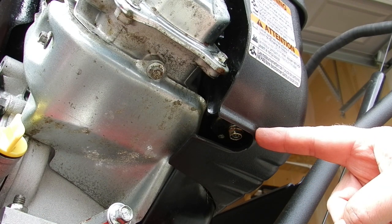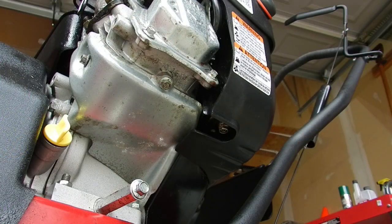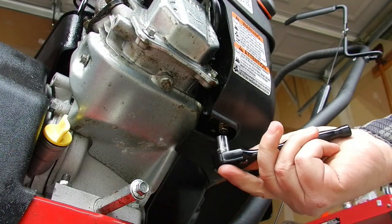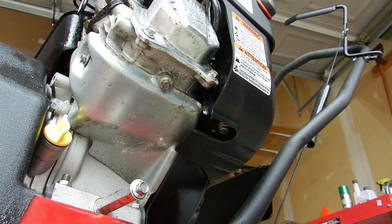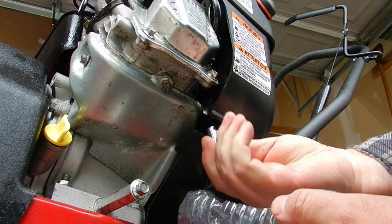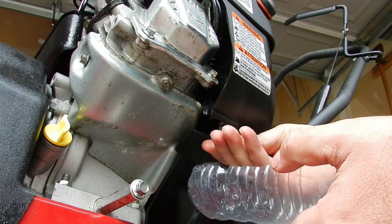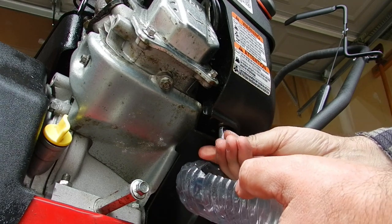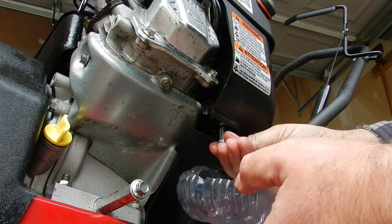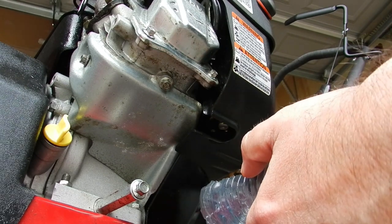The last part of the fuel system prep requires draining of the carburetor. This particular one has a 1/4-inch drain bolt on the bottom of the carb bowl. You've seen me use this catch cup before to drain other carburetors, and I can easily transfer the empty fuel into the lawnmower.